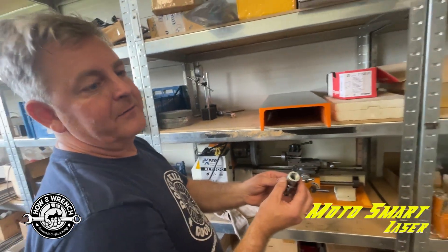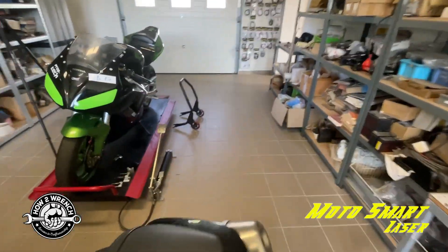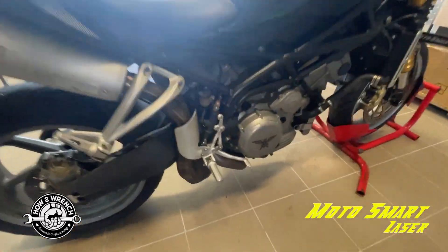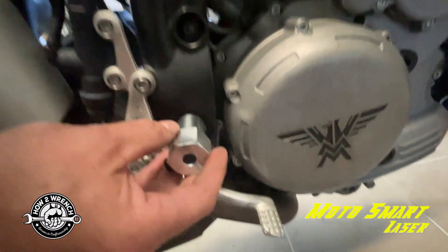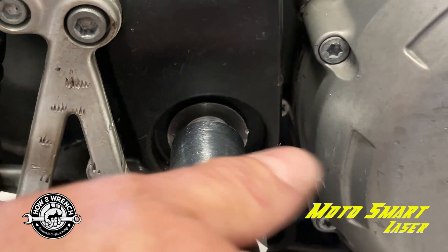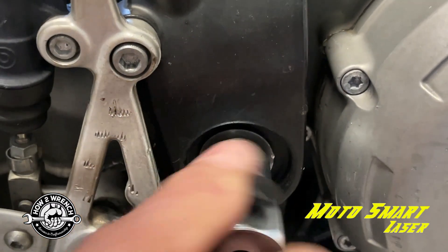It's kind of cool to use the accessories. He was making a point that when you take the nut off, you also want to look at the condition of the washer it's going to go up against — because if it were scarred from a lock washer or something, that would be a problem.